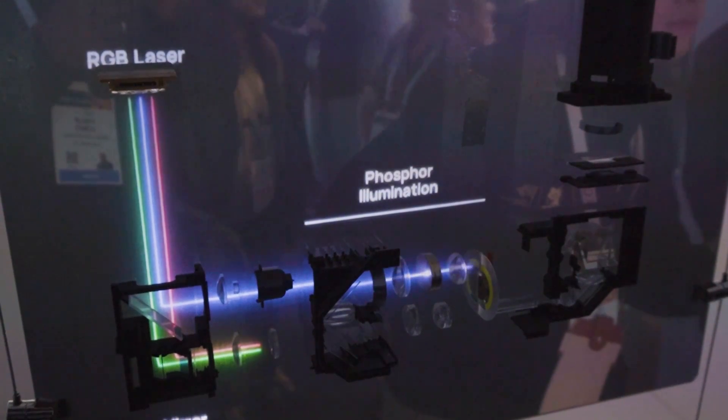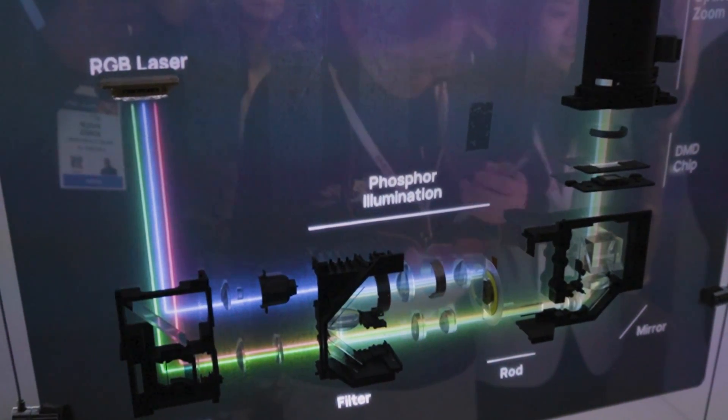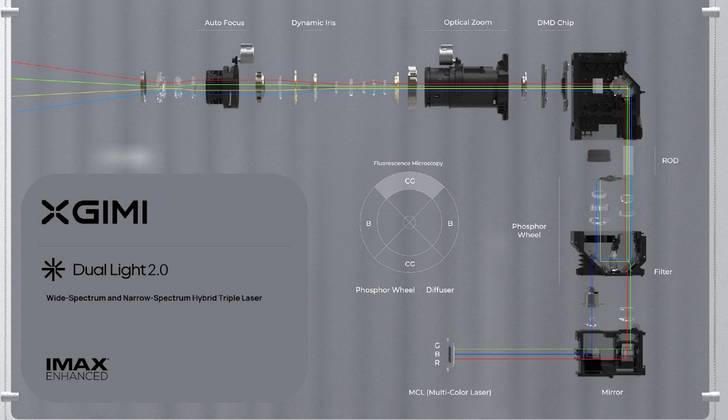As mentioned, an LED light system could only go so far, which is why you moved to this new solution — it still eliminates color fringing and speckle but gives you more brightness. Now this uses three lasers and a phosphor. Most of the time with a three-laser system you don't need the phosphor, so why add it? Because with only RGB lasers there are issues like sparkle and color edge fringing. So we use the blue lasers of the RGB chipset to stimulate a green phosphor light source, then combine that green phosphor light with the original green laser light source.